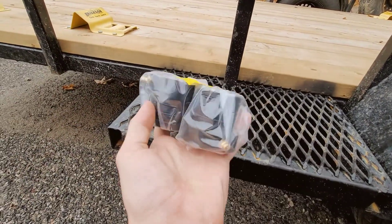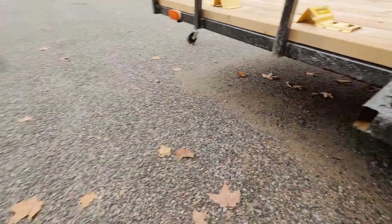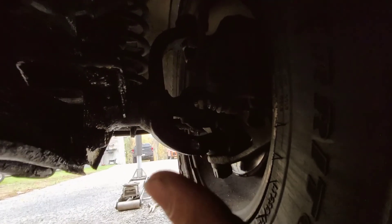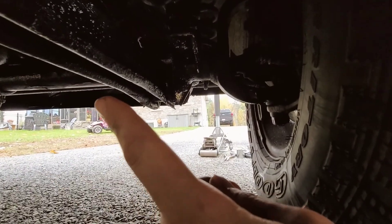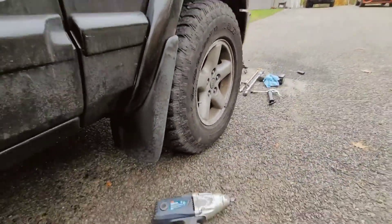So let's get into it — the outer tube seals for the front axles. Here they are, this is what they look like. Just got the two in black. They are axle seals with a greasable fitting on them. I'm going to show you how to take this apart and put it in. Essentially, where the axle seal is, there's a cover on the outside and on the inside of the axle is where the actual seal is, and they tend to leak. You can see right here — after I replaced my ball joints it started leaking, so that's why we're installing these.